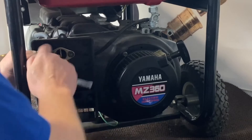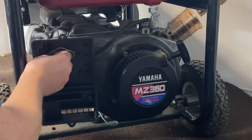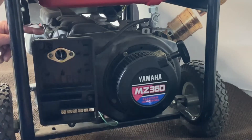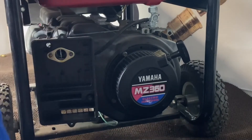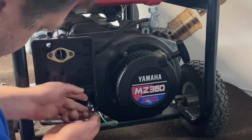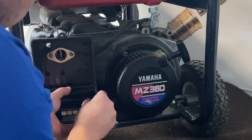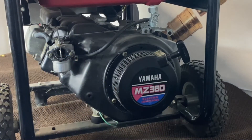Let's go ahead and get those removed. Now if you can see in here, there's a little breather tube that comes off the valve cover — just go ahead and push that back and pull it off. Now we'll go ahead and remove the bottom vibration bracket; it's just another nut on the bolt back there. That gives you access to your gasoline carb.